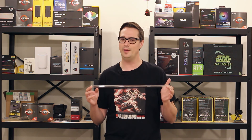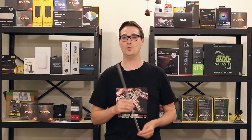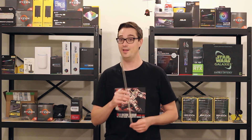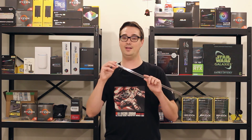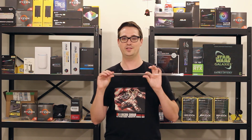Bending hard tube for your water-cooled build can seem like a daunting task at first, but with some patience and perseverance it'll pay off, and it looks great. Tip number one: measure once, measure twice, then measure again — you can't measure too many times. Doing the bend is actually pretty easy, but if you mess it up and get it out of alignment, bending it back isn't really an option. You can never truly get it as straight as it originally was.